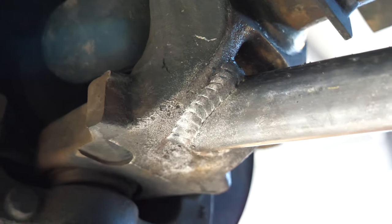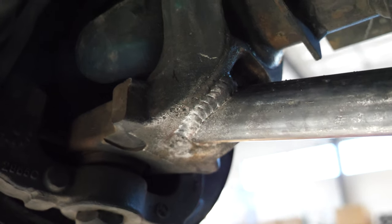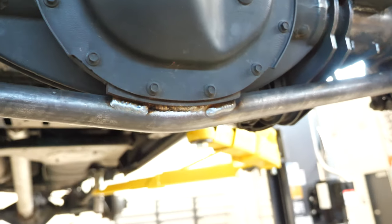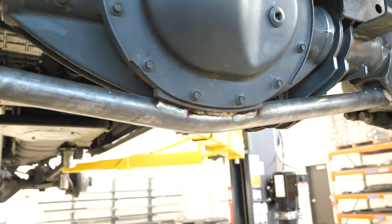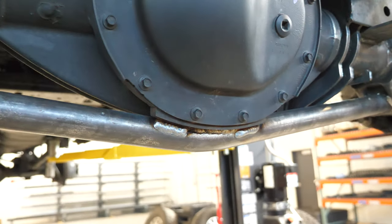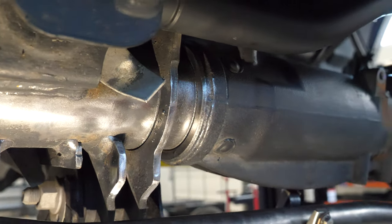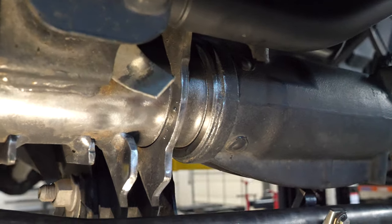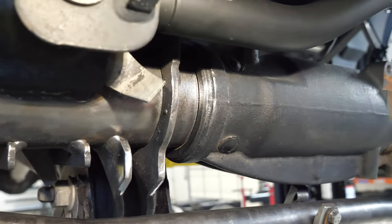We were thinking two or three passes and ended up with two. The tube fitment was good enough that we just laid a second wider pass over the top, and that's going to lock it in really well. Now we're on to the bottom seat weld for the second and third pass, which is what we want on the cast section specifically. These 2013-plus axles under real hard abuse have had people twist the differential and cast sections on the steel tubes. So we're going to try to get some welds in these corners before we put the fill plate in, to keep any twisting from happening.